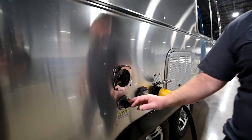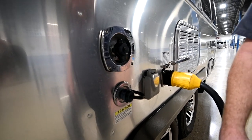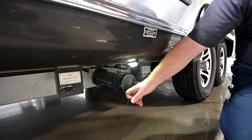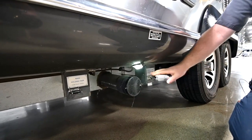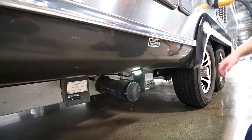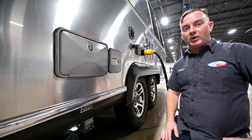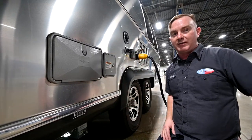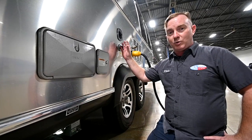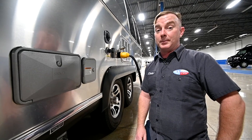Below your city water connection is going to be your waste tank clean-out valve. When you attach your water line here it's going to put water directly into the black waste tank, which is where the toilet empties — it's designed to help you clean that out. Your waste clean-out is down below. Sewer line goes here in the middle; on the left-hand side the main holding tank is your black tank and on the right-hand side the auxiliary tank is your gray tank. It also says 'wash' here to help you remember. You always begin with the main tank. Before you pull this valve the first time, attach your water line to the waste tank clean-out valve and start to introduce fresh water. Because this is a gravity drain you're going to need the maximum volume of water to help push all that solid waste out — fill it all the way up to the top before you pull that valve for the first time. You'll notice the water comes out of that port much faster than you can get it back in, so when you see the flow diminish, close the water, close the valve, continue to allow it to fill back up to the top with fresh water. Flush this tank out five or six times until it goes from pretty muddy to pretty clear.